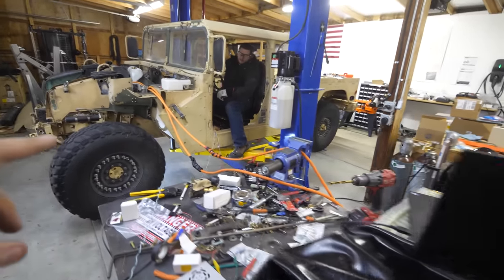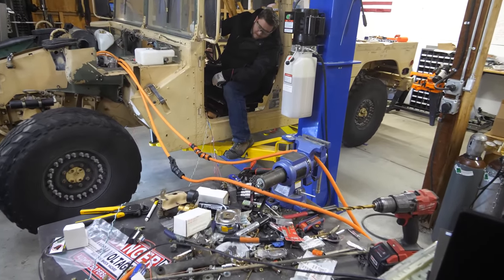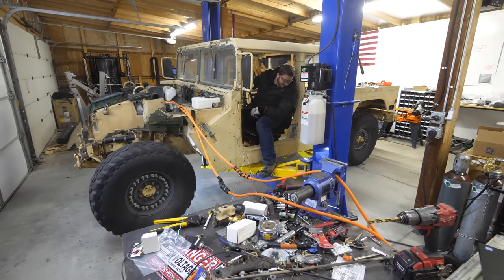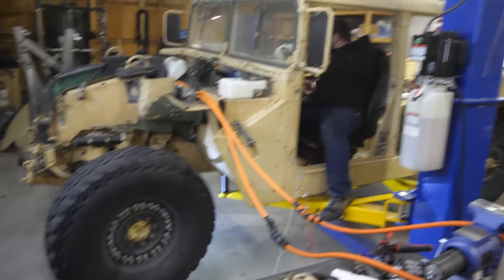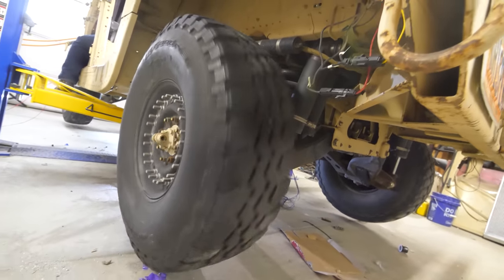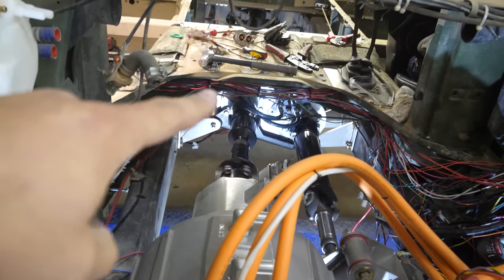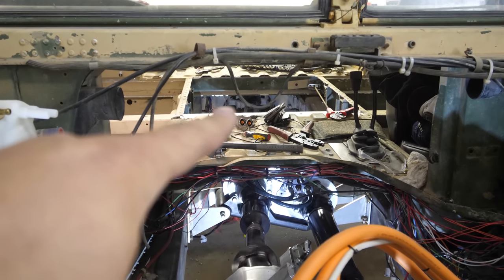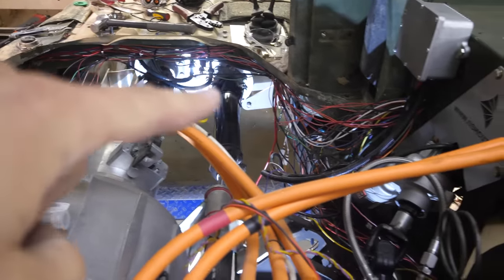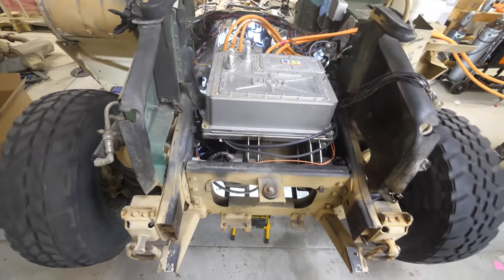We have Jacob in the driver's seat now — we're going to get all four tires spinning at the same time. Now we're in regular drive with the wheels spinning faster before we were in low gear for crawling. What's super cool is you can see the drive shaft coming from the motor to the transfer case, as well as through the hole in the floor going from the transfer case to the rear differential, and then coming back to the front differential to spin both front tires.